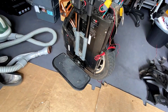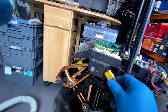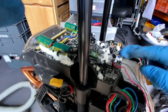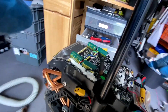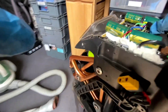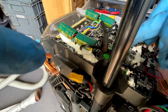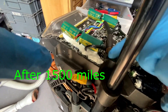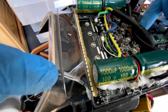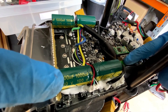Taking all the bits off from the King Song — as you can see the shell is all gone. It's very important to disconnect the battery and all the connectors from the battery and turn that on to discharge everything on the circuit board. Once there's no power in there, then you should be able to work on it. You can see there's a bit of rust coming through here — that's condensation coming through from the bottom. I'll just seal that up. The King Song circuit board is actually waterproof — it's got some sort of silicone on top of it to protect it from moisture.